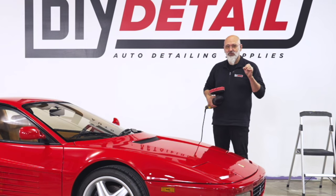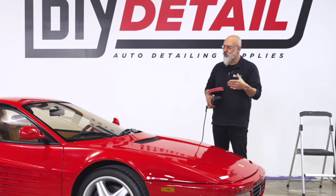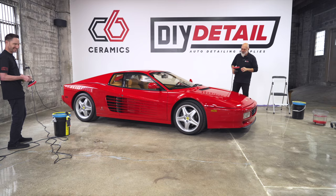But people don't realize how much material they're taking off with the clear coat. Now, a single stage is a little softer than clear coat, so you are removing a little more material. But on clear coat, you're still removing that material. You just don't see it. And if you start seeing color when you're removing clear coat, then you have a really big problem. Yeah, exactly. So off we go.